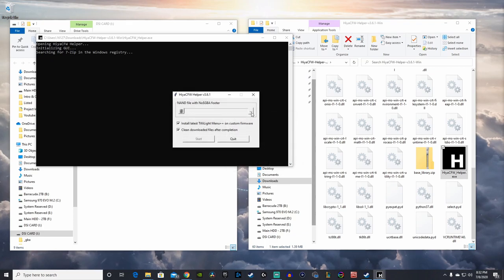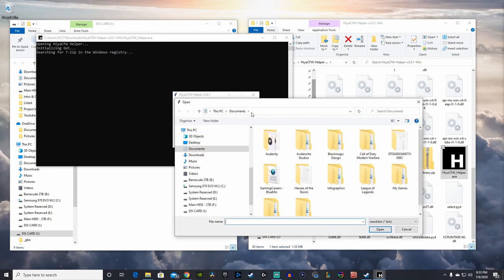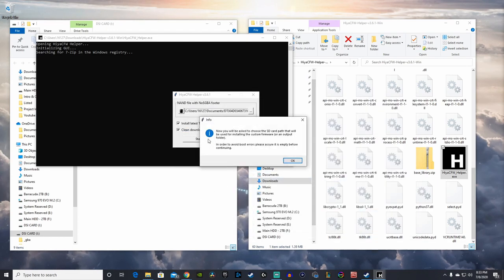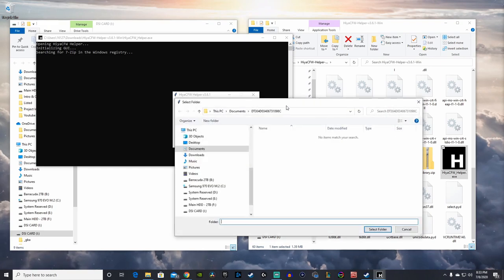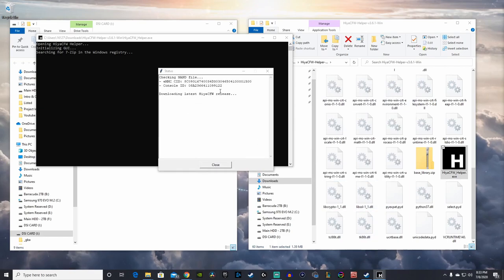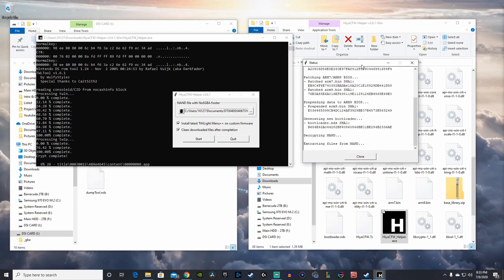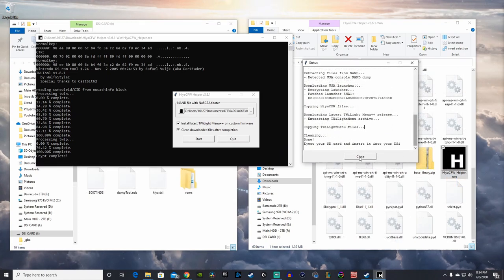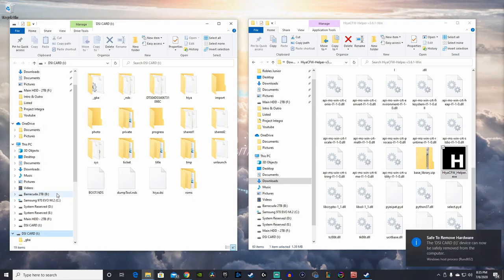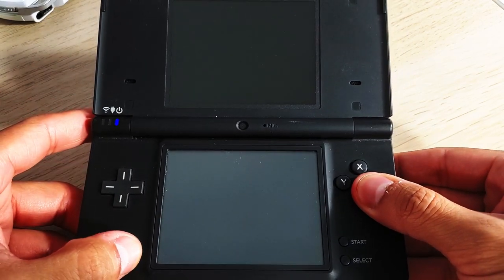Click the three-dot button and navigate to find your backup of your DSi, then click Open. Press Start, and in the new pop-up window navigate to the root of your SD card and press OK. Click Open — this process takes about 3 to 5 minutes to complete. When it says 'Done' on your pop-up screen, eject your SD card and insert it back into your Nintendo DSi.